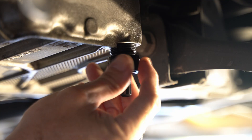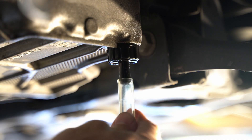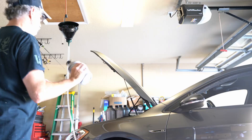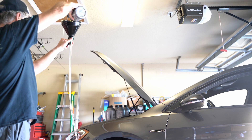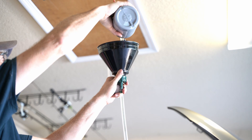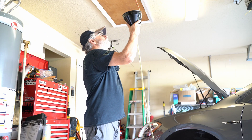Something that's different with the seven speed versus the six speed: the gear oil level is properly set when the overflow pipe is unscrewed two turns — the level is two turns below full. So I went ahead and screwed it in all the way here just to fill it up, but when I do my final fluid level setting, I will unscrew it back two turns. I got that in just hand tight. Then I'm plugging in the adapter for the oil filler — I got this off Amazon, it's one with a funnel. I like this because I can use it for other projects. I hung it with a bungee cord from my bike hooks on the garage ceiling to hold it as high as possible. Shake the fluid per the instructions and then just fill it up — the higher you get it, the quicker it goes, and it went really quick. The key is if you can keep air from getting in the line, it'll go a lot faster — once you get an air bubble in there, it slows to a crawl.